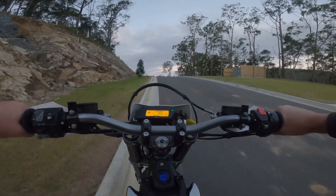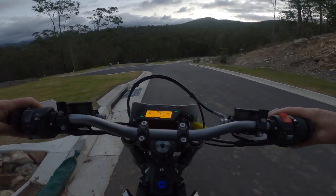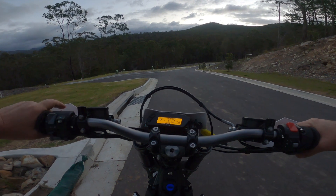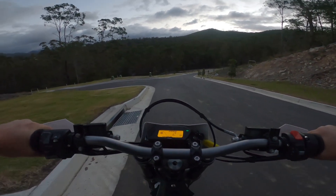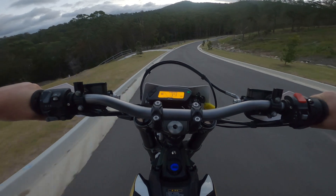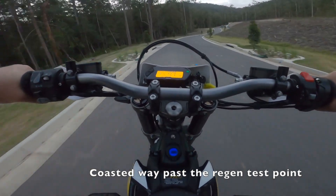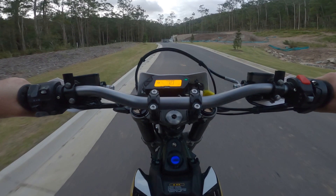So what I'm going to do now is change the setting down to zero — zero on the brake regen and zero on the coast. That's zero regen braking on the brake lever and zero on the coast. Last time we got up to 33 kilometres an hour. Let's see how fast we go this time without the regen. And you can see we're past the point where we levelled off before, considerably, and still going fast. You can see it makes quite a large difference.